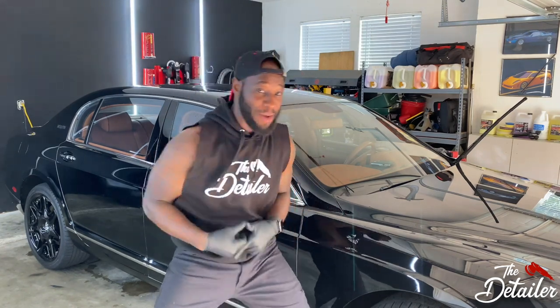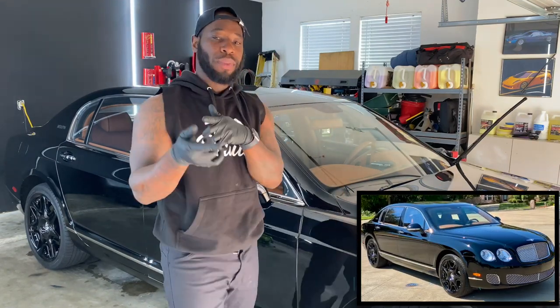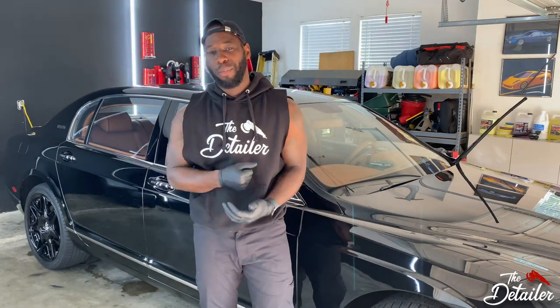Yes, sir. You guys see what we're doing inside this video. We've got a black Flying Spur, the Bentley. Just in case y'all don't know what the Flying Spur is, it's the black Bentley. I'm going to show y'all how to polish out this black Bentley. He doesn't want a ceramic coating or anything like that. He doesn't want a real good paint correction, so I'm going to show y'all how to do a one step paint correction.